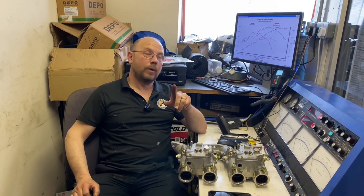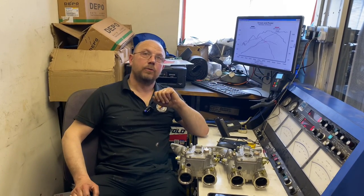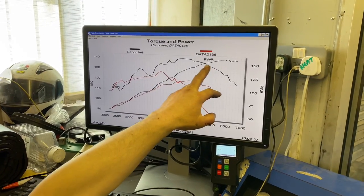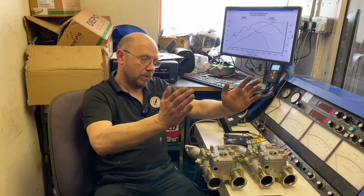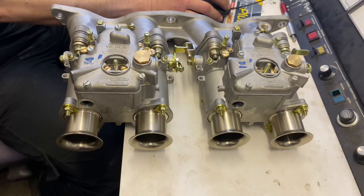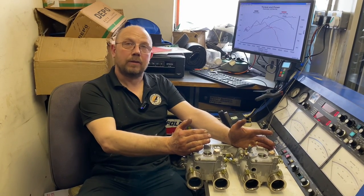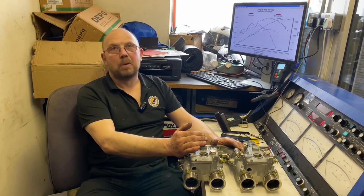So that's that test done. We've got a comparison here between this cylinder head and cam combination with the big 45 DCOE carburetors compared to a standard engine — the standard engine being in red. The 45mm carburetors are actually bigger than what my client has on his car. What I'm going to do next is fit the smaller 40mm carbs, run it up, see the power difference, and then my client can make the decision whether he wants to stick with what he's got or spend the money on the upgrade. In my opinion and experience that head really needs the big carbs currently fitted to get the best from it — but it's not my money I'm spending.